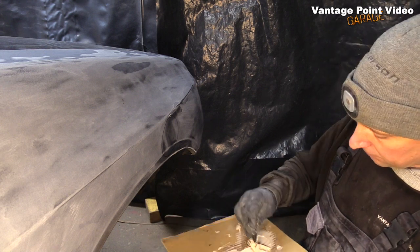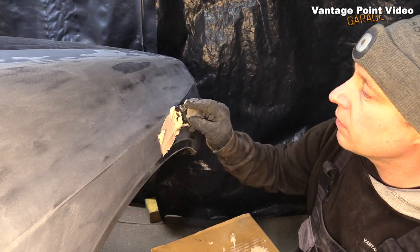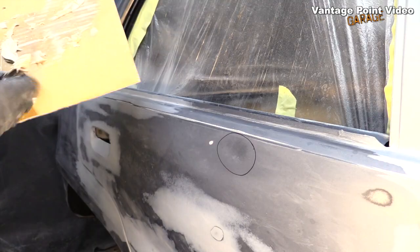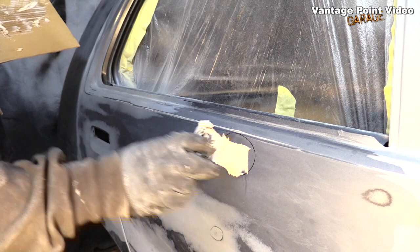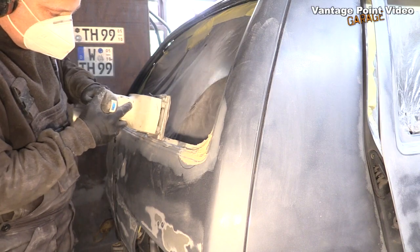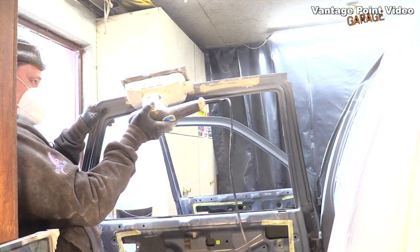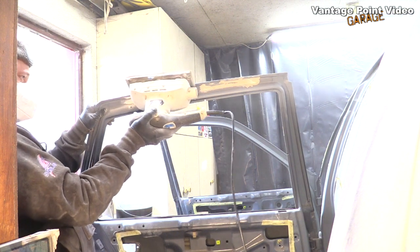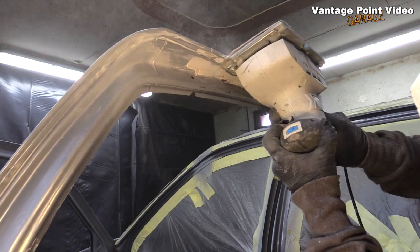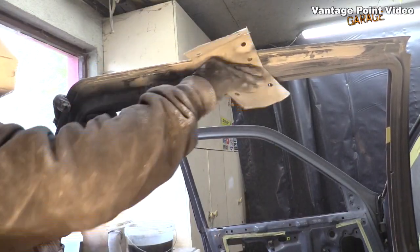This is one of the bigger ones on the front wing. Starting in the center with these and spreading out the filler. I carried on around the car with a couple of more batches and flattened out all these little dents. I found my old square electric sander was best for getting in at the inner lip of the rear window surround, and also for these door tops. I even got into a bit of sculpting with the angle grinder. Down to some primitive hand sanding there.